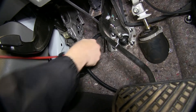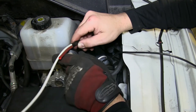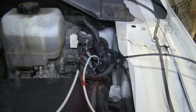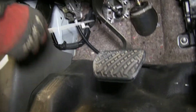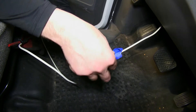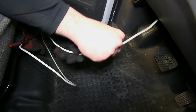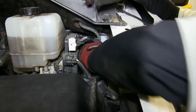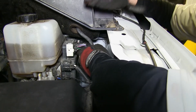You can also use a pull wire to route through the grommet. Now we've got the white wire pulled into the cabin of the vehicle. I'll go ahead and take a blue piece of tape and mark the wire so that I can note that this is the power wire that runs from the brake controller back to the 7-pole for the trailer braking. For this application, because of its length, we're going to have to get an extra piece of gray duplex cable.